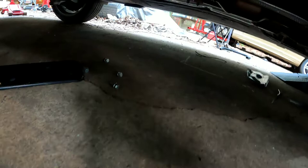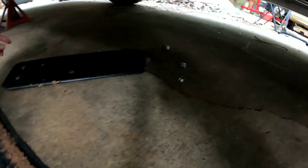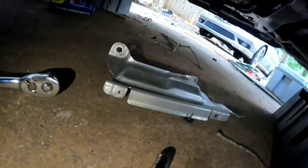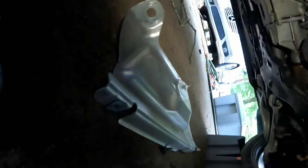After that, we're going to put this black plate right here with four 13mm bolts — it goes right up in there covering the exhaust. Then put this little bracket on the bottom of the exhaust: one bolt goes through the middle and one goes on the end, both E10s with the longer one in the middle. Last, I'm going to put this plate up — one 10mm nut goes up there and the other end clips in, with screws that are 8mm and 10mm.